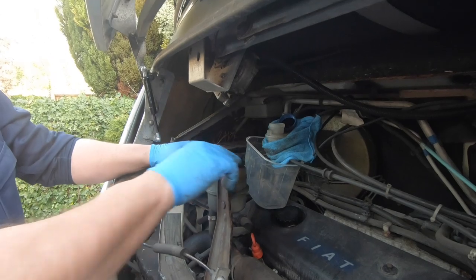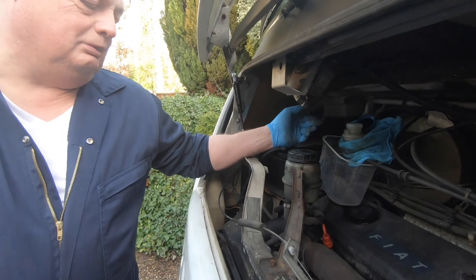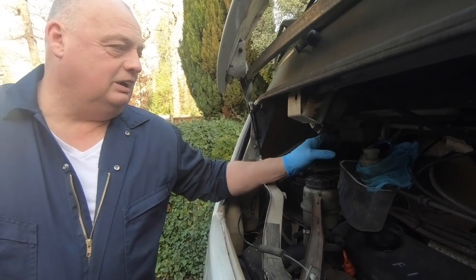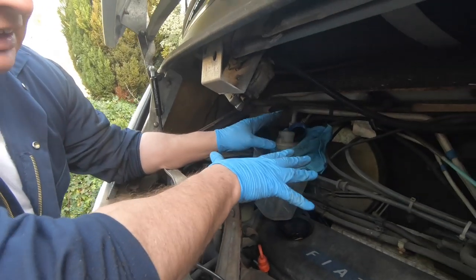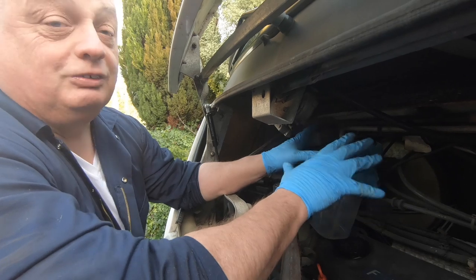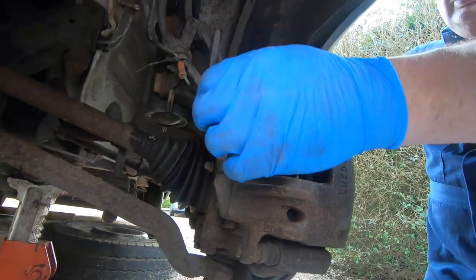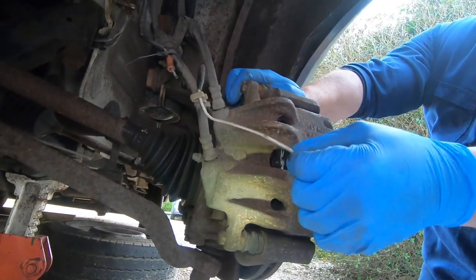It's just a safety thing really, to stop it doing any more damage. You'll always want a receptacle and a rag because effectively brake fluid acts as a paint stripper. So any rags or anything contaminated by brake fluid — put them into one bag, tie it up, make sure everything's clean, and throw it away responsibly. That sensor is the pad wear indicator.